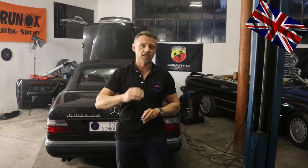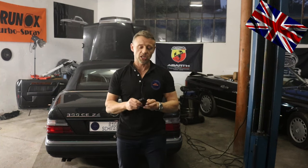Start checking the headlight assembly first, then step by step the vacuum lines with help of that vacuum pump to detect leakage. You instantly see the reaction of shorter or longer beams by creating a vacuum or allowing more air pressure. Check all lines for cracks — sometimes rodents damage them as well. Happens mostly when these cars are being put away at winter for hibernation.